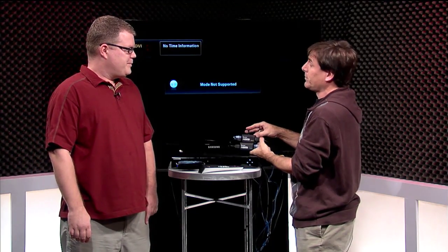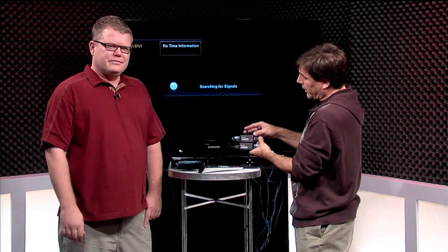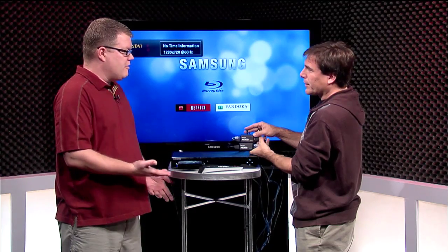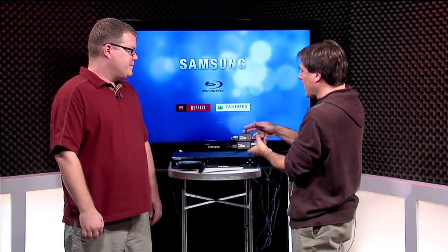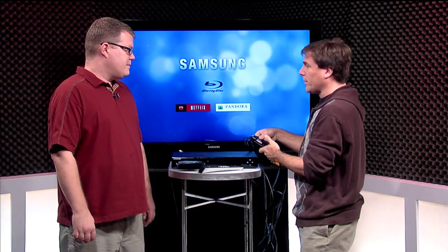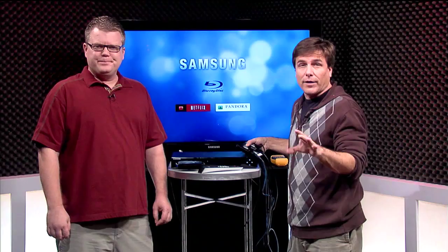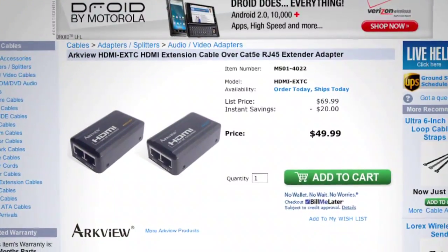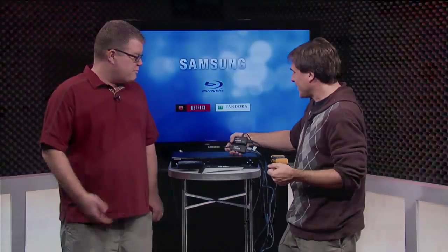For my DirecTV box for HDMI — which is literally 1080i or 720p — it works great. And you're using an existing connection already pre-wired in your house. If you want to do higher resolution, I suggest Cat6 cables, not Cat5e — high quality — put it in and give it a try. And it's about 60 bucks for the receiver, the sender, and the power adapter. Not bad at all.